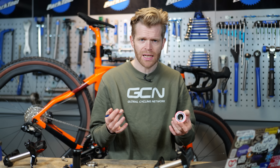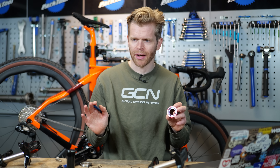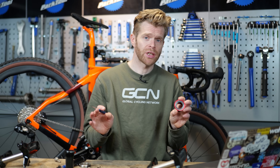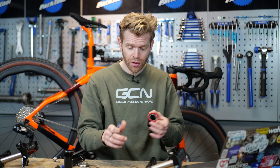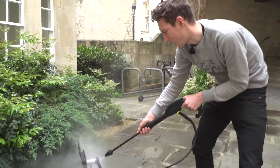The number one way in which you will contaminate your bearings is through jet washing. I used to jet wash my bikes all the time — I've made videos about it and I've seen pro mechanics doing it. There were always people in the comments saying you shouldn't jet wash your bike, but I didn't pay attention until I spoke to engineers who told me absolutely do not do this — we've tested it, here's the evidence. Now I don't jet wash my bikes and I would advise you don't too. The water is so high pressure that it easily gets past the seals. Even with adjacent jet washing, the pressure from tiny water particles ricocheting off other parts of your bike can still get through the seals.